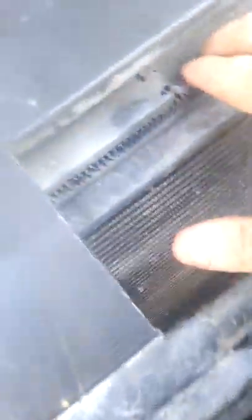You can see the stickers with words — try to read them even if you're not able to. Now I'll show you something that people don't really realize. That hose goes from the turbo, goes down here into this thing. If you look down there you can see where it technically goes in by the bottom. It goes through this center piece, which is an air cooler, out the other side, comes up to the throttle body which is electrical, comes up through here and into the intake. This is the intake piece — goes into the center of the engine. This is only supposed to have air through it.